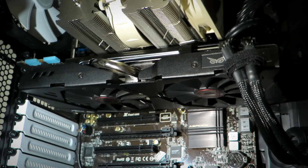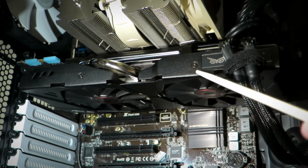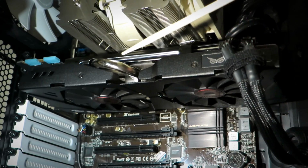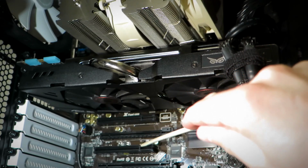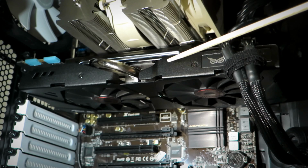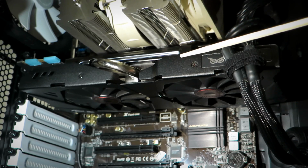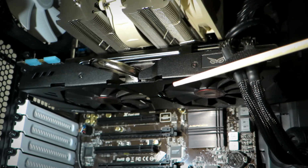The next stop on our tour is the graphics card, which is also called the GPU, which means the graphics processing unit. And the GPU slots into the motherboard in one of these PCI Express expansion slots. It is responsible for the graphics that the system outputs. And obviously, if you are an avid gamer and you want to play games with good graphics, the GPU is going to be a very important part of your system.